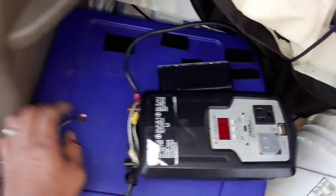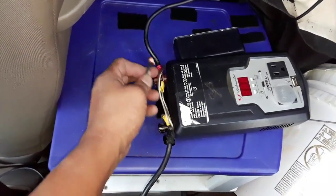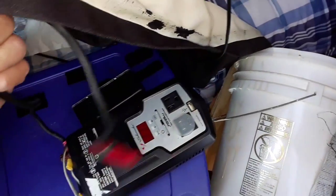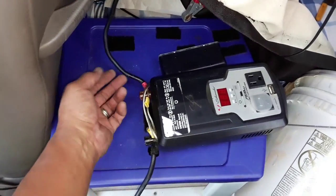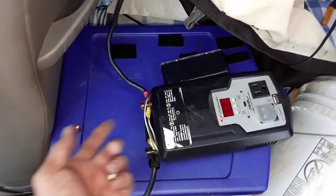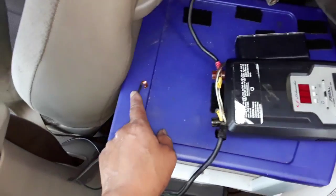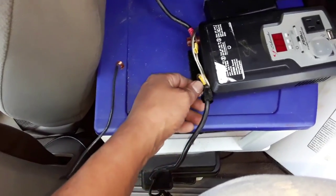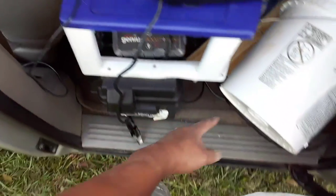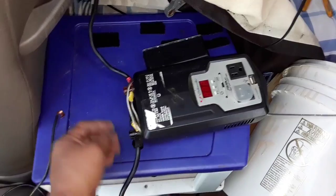The inverter I used before was a 400 watt inverter. This one is a 750 watt — you can see it says 750 — and it was inside Little Blue Too. I went with this one because it's just more powerful. We're going to hook up the positive wire here to the red input on the inverter. You can see there's a connection to hook up to a battery, but we're not going to hook up a house battery. We'll hook the positive wire from the vehicle battery to the red on the inverter, and then run the inverter's negative to a piece of metal on the vehicle to complete the circuit.